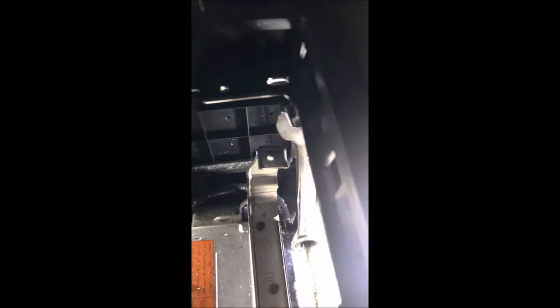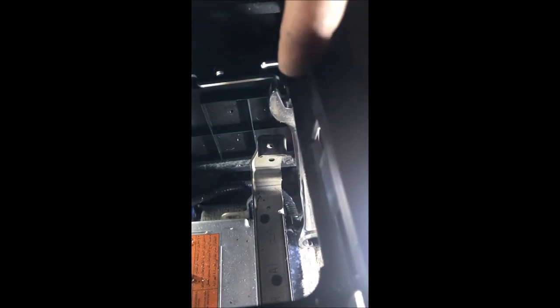It just comes right out. There are four screws — I've already taken out three of them. Once you've got them all free it just comes right out. You only need to do these two back screws; you could actually leave your cover on if you wanted to. You just want to disconnect these two holes from the bracket here and here, so you've got the freedom to lift up the back of the center console and access that third bolt back there.